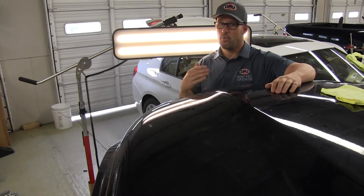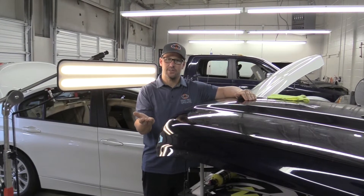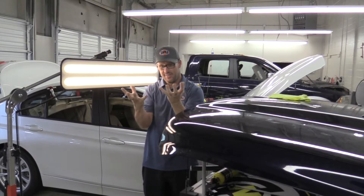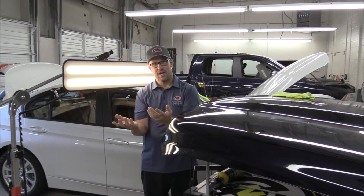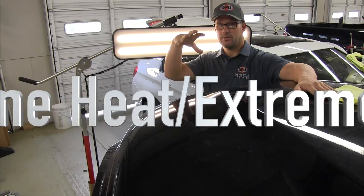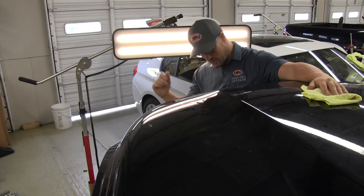This week we're going to change things up. The reason dry ice would work is because of contraction. The only way that metal can change in this form would be that the metal contracts so quickly and so hard that it'll draw the metal in. So I started thinking, if that didn't work, maybe we can actually take it from heat to cold — expand with the heat, dry ice again, contract — and maybe that will pop the dent out. So that's what we're going to do here.